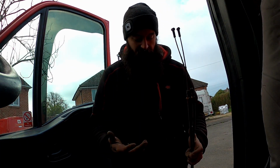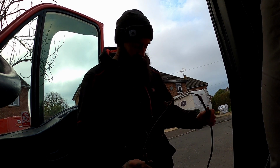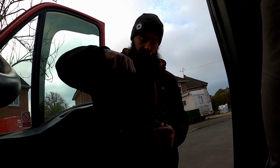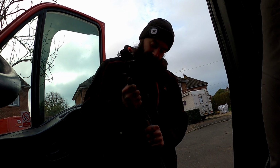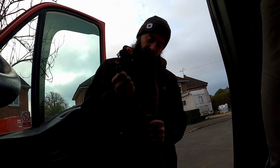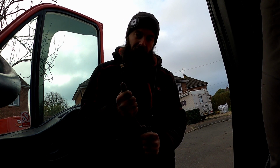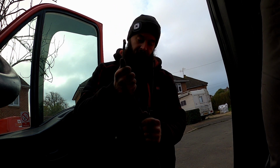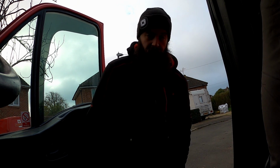Now, excuse the mess of me. I'm just covered in shit from diving underneath this van. But these are your handbrake cables, look. What I mean by one was sticking. See, you have to force that in and out. Same as that one. If they're not fluent, don't get me wrong, you could probably squirt some stuff down them and make them come back to life, but you have to keep doing that when the boots are split on the ends, you see. So yeah, new ones in it wants to be. Happy days.